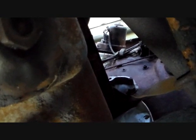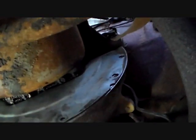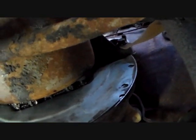And then what's going to go on here is right up there. See that bolt that's right there where that brace is going in? That was the one that I forgot about. That goes through from the front to the transmission. That's one of the long bell housing bolts, like I was telling you. There's a long bolt here on the bottom, and the lowermost bolt on this driver's side is a long one too. And then what's going to happen here is you got 2 bolt holes there. That's where the side brace for the transmission goes in, and I'll show you that. But that's where it goes.